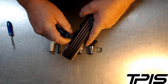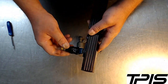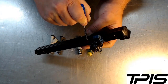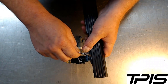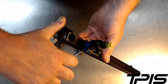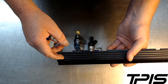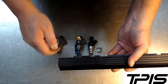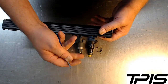You can put a little grease or oil on the o-ring, then slide the injector in — you have to have the clip in the right spot to get it in. You can see here there's a groove machined into the fuel rail, same as the TPI rail. Once the injector is in, use a small screwdriver or a pick and move the little tab over — now that injector can't go anywhere. Without the right clip, when you turn the fuel pump on, the injector will literally move down due to fuel pressure and go down into the intake manifold.